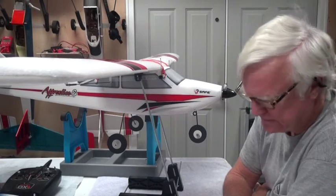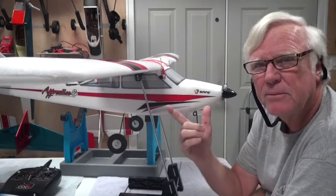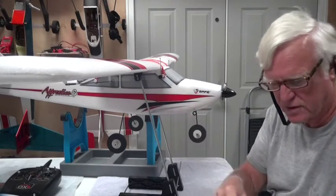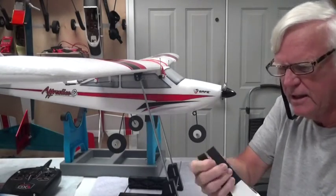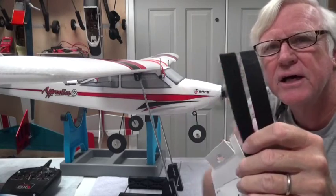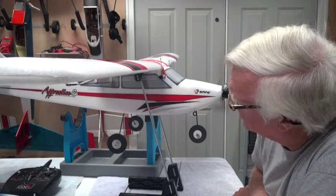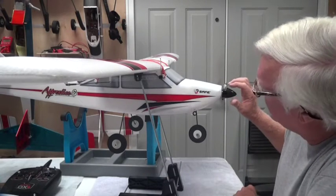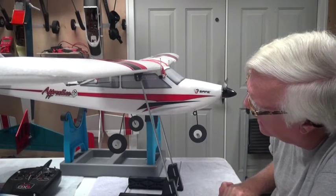That just means the battery should be all the way to the tail end of the battery compartment. After this video, I'll take some Velcro — I get this Velcro at Walmart — and it has both the fuzzy side and the hook side. You just cut off what you need and stick it on. In this case I'm going to use the hook side on the battery, because the fuzzy side is already on the bottom of the battery compartment. I think that's a pretty good center of gravity. Note how much it changed — if I had that battery all the way forward it would be a whole lot nose heavy. Now with the battery all the way to the back it looks just slightly nose heavy, and that's where you want it.